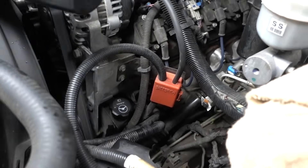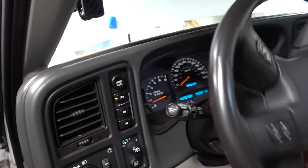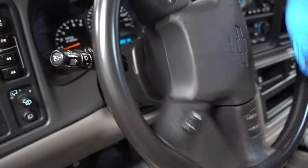At this point the job is done. I've topped off the reservoir and made sure there are no air bubbles by cranking the steering wheel from lock to lock multiple times. The only thing left to do is start it — so let's take our key and start it. Sounds good. No issues, no sounds. Let's crank the wheel from lock to lock just to make sure. Thankfully, that went exactly as expected. I did not have to start the engine, which made me feel a lot better, and I was able to get the entire system flushed out with new synthetic fluid.